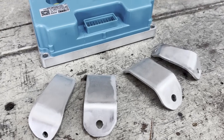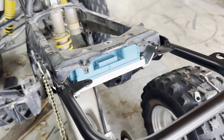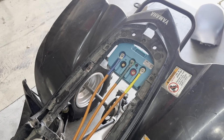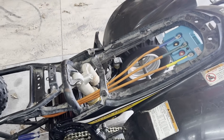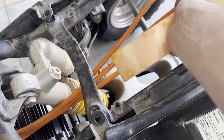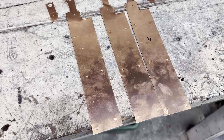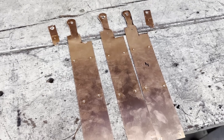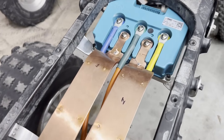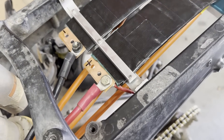Here's how I'm going to mount the controller — it's pretty self-explanatory. Another reason I wanted to mount it here is because the motor wires are the perfect length. The three-phase AC electricity these wires carry is super efficient, so it doesn't really matter if they're pretty long. However, the DC electricity that the battery outputs is not efficient over long distances, so I'm going to use some copper to give it the absolute lowest resistance. This will also allow me to bolt multiple cables to the controller. For each terminal, I cut three copper sheets out and added two little extra pieces on the thin part. Right now I'm just using one set of cables, but I can bolt three sets in the future.